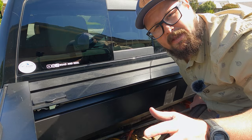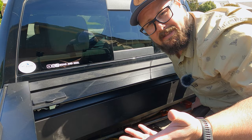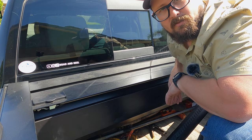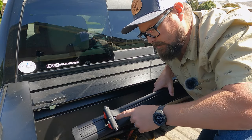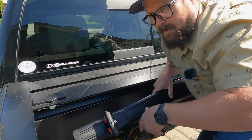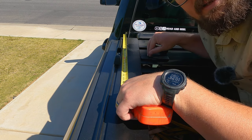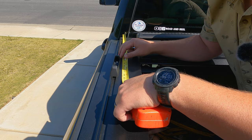Get all four mounting feet ready to go. My biggest bike has a 29-inch tire, so I'm dividing that roughly in half — about 16 inches — to determine how far forward the racks need to go. Using my measurements coming out to the 16-inch mark, I noticed I'd be interfering with my tonneau cover handle, so I'm actually coming back to the 20-inch mark to give plenty of room to get it up.